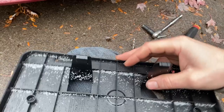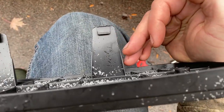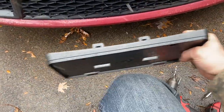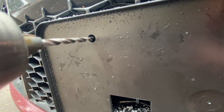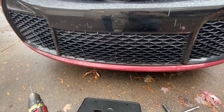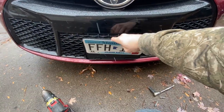If you want more adjustability or if it doesn't perfectly line up with the holes in your grille, you could take a razor blade - heated or not - and trim this tapered piece down a little bit, or even cut the alignment tabs off if needed, since the screws are what actually hold it on. We're going to put it back in and drill the holes now. Get the drill centered in the hole - as you can see it went through very quickly, which gives you a hint of how thin this plastic is, so we can't go super tight with those screws.